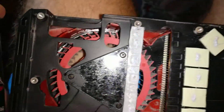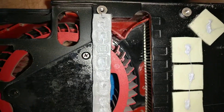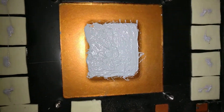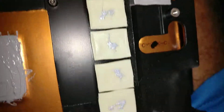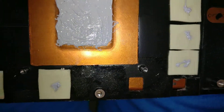You can see these are the screws of the chassis. I just applied some thermal compound on the GPU cooling area, on the copper base shim there, as well as on the VRM pads, since they are three years old and were baked at around 95 degrees Celsius.